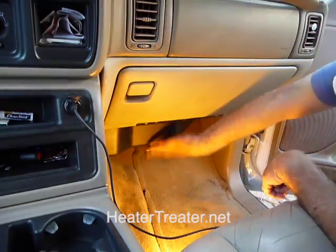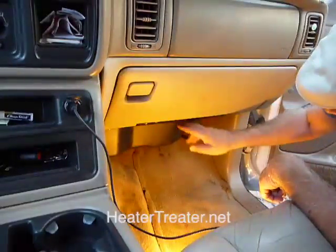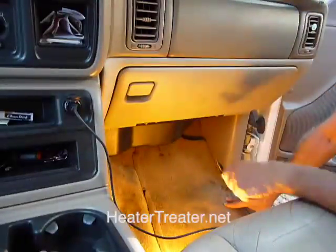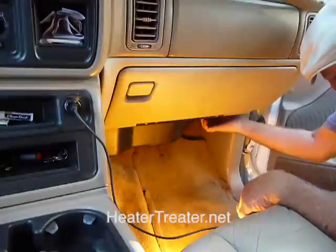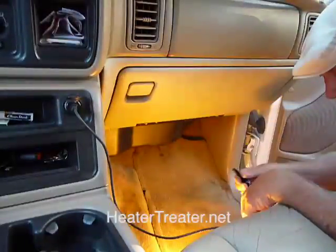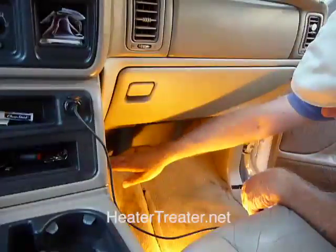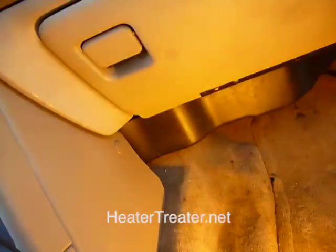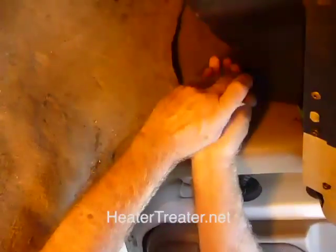The thing we've got to get out of here is this little kick plate underneath that is covering up the bottom of the plenum box. There are two screws that hold that in place, and the first one is right here — it's going to be real easy to get to. We'll get that with a 7mm ratchet. The back screw is kind of in here above the transmission tunnel, and you can feel that. Let's take that first screw out.